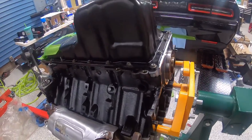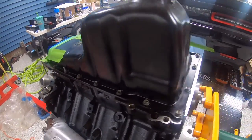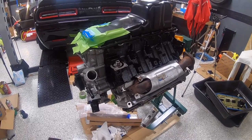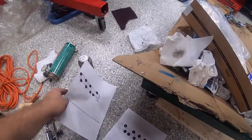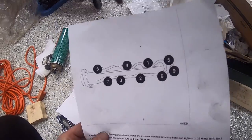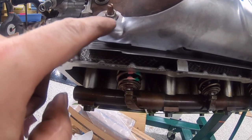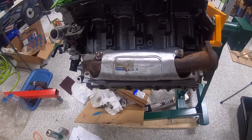The sensors include the crank sensor on the driver's side, oil pressure/temperature sensor, water temperature sensor, and cam sensor. The flex plate we can't do yet — it has to be done once the engine is off the stand on the cherry picker. One thing to note: the passenger side exhaust manifold has eight bolts while the driver's side has nine — one more on the driver's side. Also used a little anti-seize on the threads of the studs before putting the nuts on the heat shields, just to be nice to whoever works on this next.